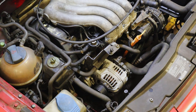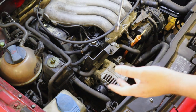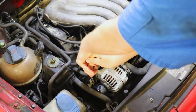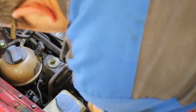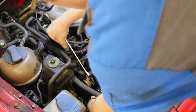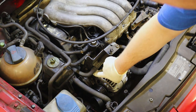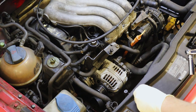The first thing I'm going to do after I get my battery unhooked is remove my serpentine belt. Behind this little hose here, you'll see a nub — you pull back on it with the open end of your wrench. This does have some spring pressure behind it, so be careful. You're just going to slip this off of the alternator like so, and then gently let it spring back.